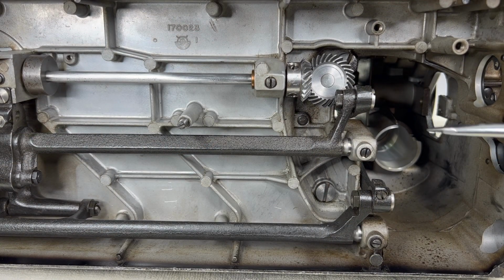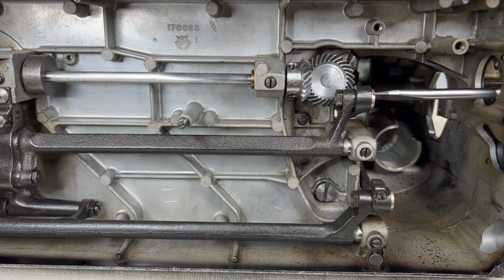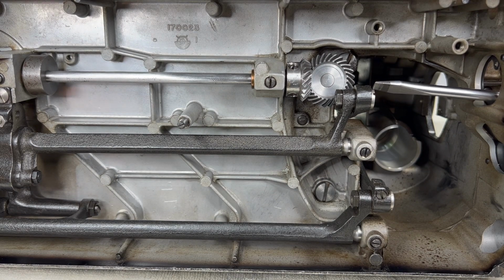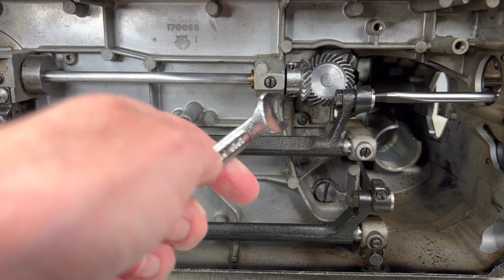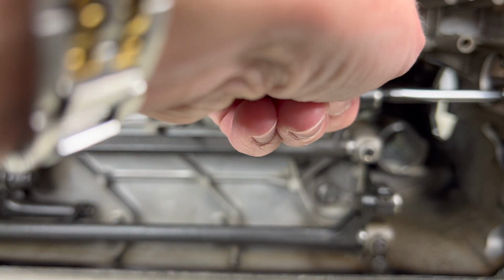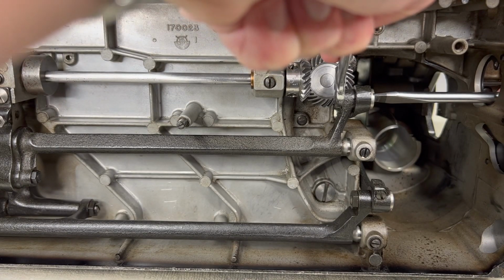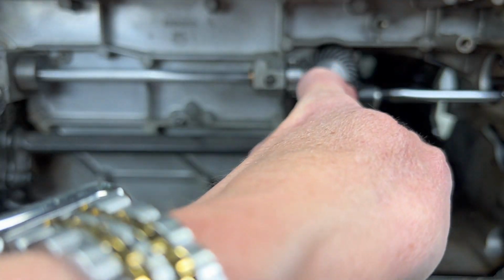First thing I'm going to do is I'm going to look at the angle of the slot on this screw head. I want to just kind of get a visual of how it's turned, in case I bump it out of place or something while I'm tightening up the nut. Then I'm going to put my screwdriver into the slot, and while I hold it steady, I'm going to take my little wrench, just about lost my wrench, and I'm going to tighten the nut by turning it down towards the back of the machine.